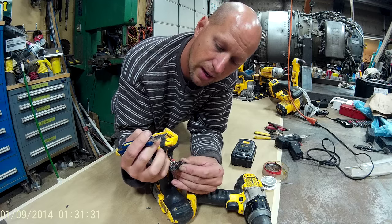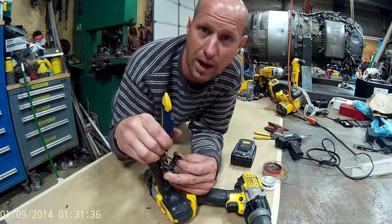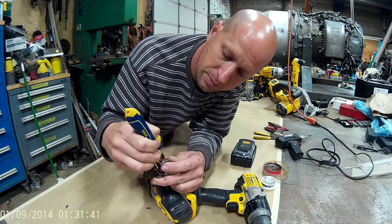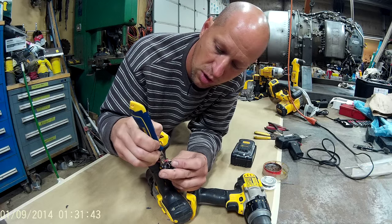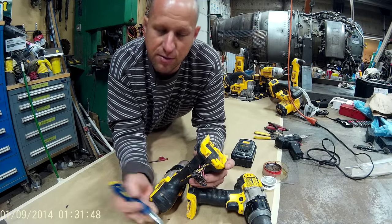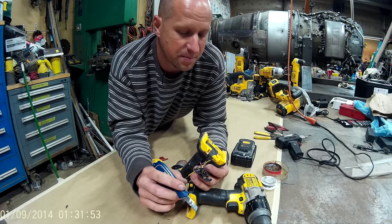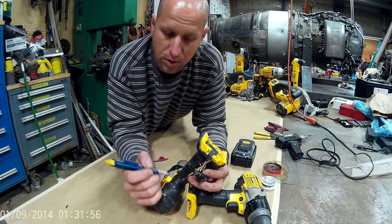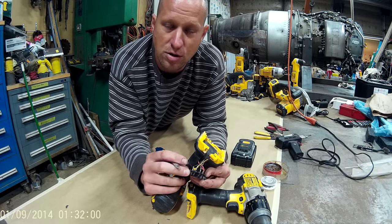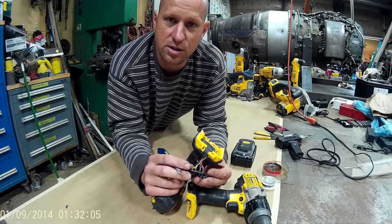So how do you fix it? Well, you put it back just like the factory did — cut the wire off, strip it back a little bit, and re-solder it on there. So if you come across one of these tools showing that problem, that's the first place I would check. This one's made a liar out of me, but I've probably fixed four or five tools with that, where they've broken right there at one of those two small wires. I hope that helps somebody and gets their tool running again.